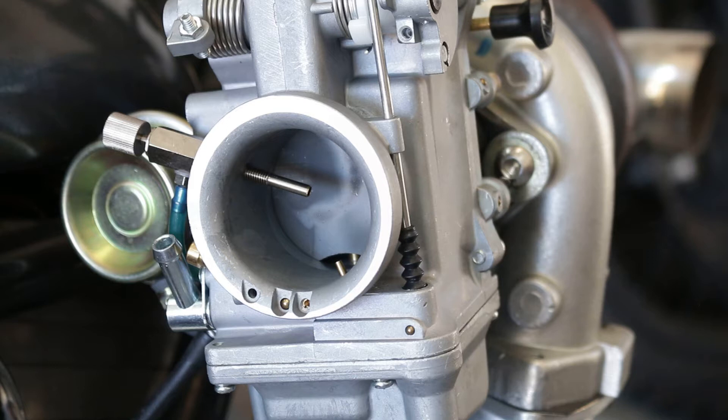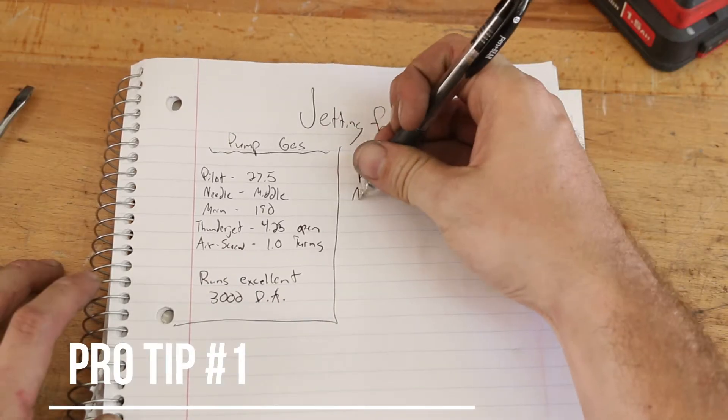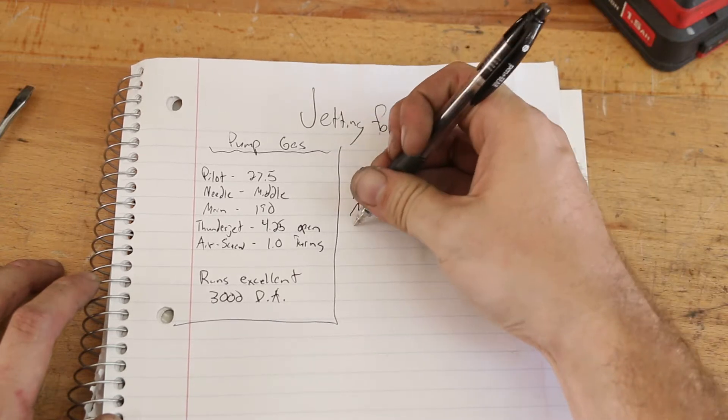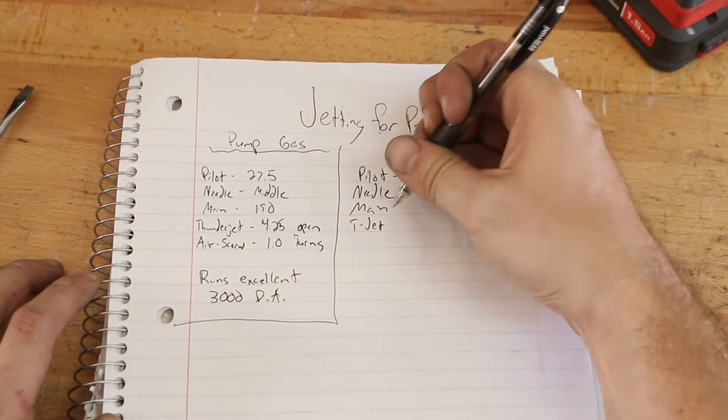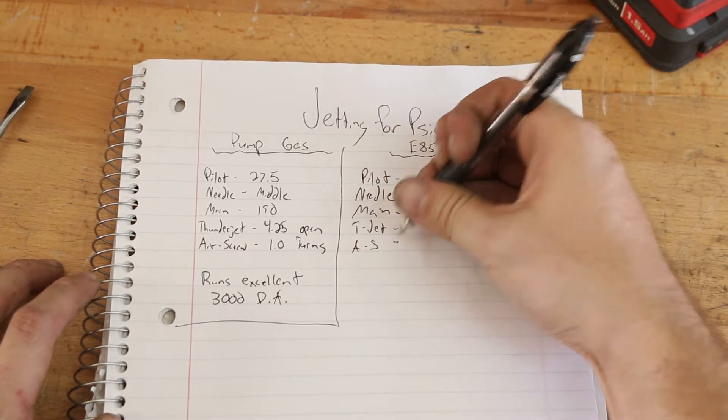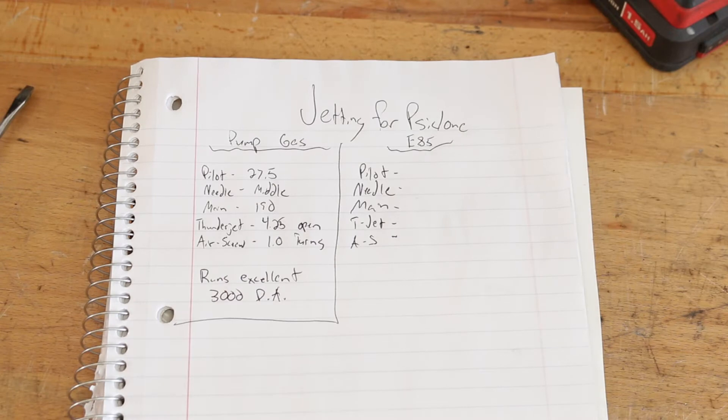You'll notice that I have a power jet installed on this carb, and the specific power jet is adjustable by a knob on the outside. It affects the fueling from about 5/8 throttle and above. I strongly recommend installing a power jet when tuning carbureted setups, especially turbocharged ones. Pro tip: keep track of your previous and current jetting setups by writing everything down in a notebook. It's easy to forget which jets ran what way, and if you don't keep track of your progress, you might find yourself becoming very frustrated by not making any progress.